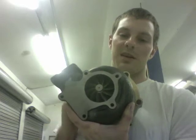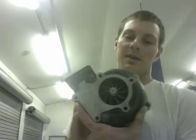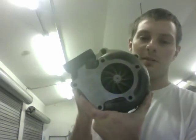If you have experience with machining, all you had to do was actually bore out the inducer. The exducer was a little bit more space — probably about a quarter millimeter bigger — so I was able to just leave that. So that was nothing to really worry about.